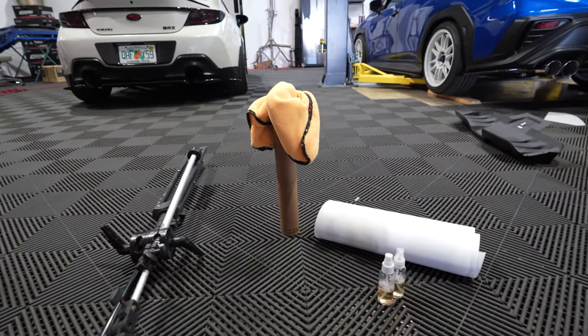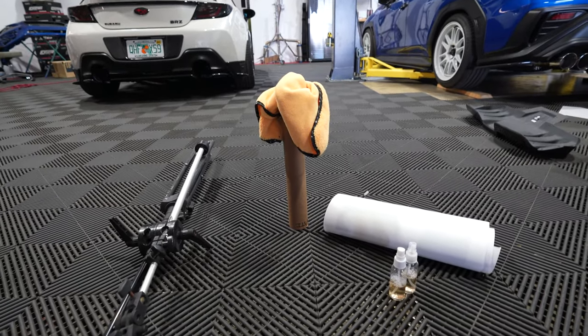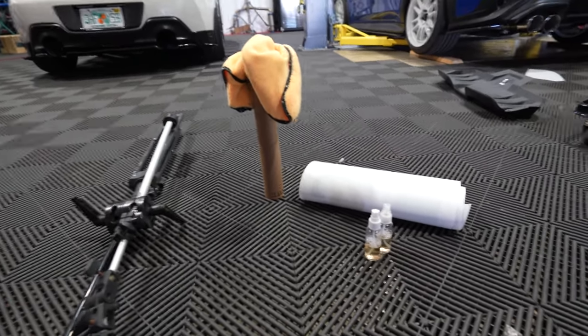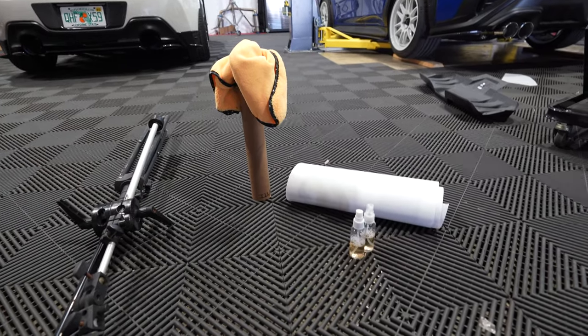Do not install these things in the cold. The vinyl becomes brittle, it's not easy to stretch, and it's not easy to get it to stick — especially if you're doing a wet application like we're doing. Let me get this whole thing set up in that front right corner of this vehicle and we'll get on with our install.